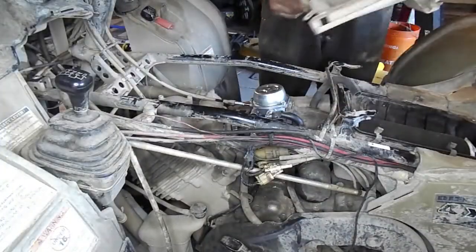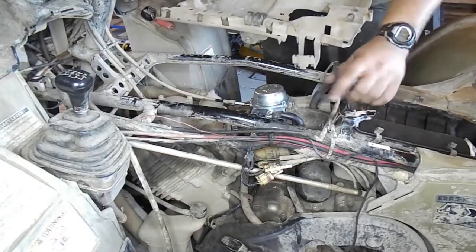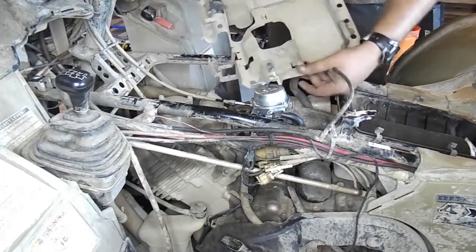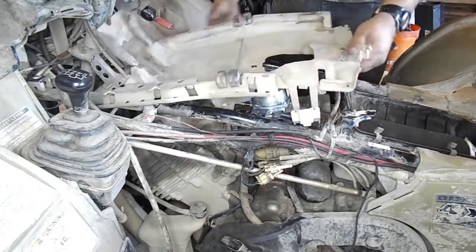Next, we need to place the plastic guard that goes under the gas tank back on. Be patient with this. Again, be careful the wires are on the left side of the four-wheeler as you move the plastic guard back into place. Make sure to run the hose for the airbox through the plastic as well as you put it back into place.